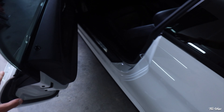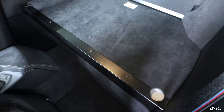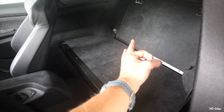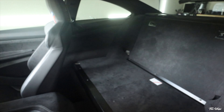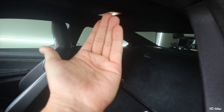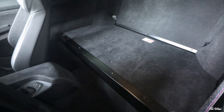I am very excited to finally get a cage put in this car — it just feels so weird and bare without it. You can see the factory mounting points right there; once I remove everything I'll also show the screw points for the harnesses. There's also a little crossbar piece that goes in the middle to match the OEM cage. We looked at where the factory cage sits in relation to the dome light — it's a couple inches behind that — so all the angles are going to be pretty much perfect to OEM.